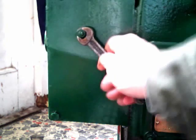To change the timing of the engine, we need to remove this cover here. There are two bolts — I think quarter Whitworth off the top of my head. Actually the top one's a nut and the bottom one's a bolt. If you remove these two, you can take the chain guard off. This is of course a magneto chain. There are two sprockets behind here and the relationship between the two sprockets gives you your ignition timing.